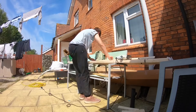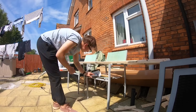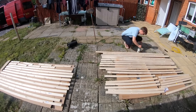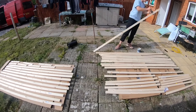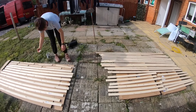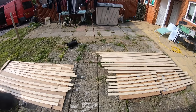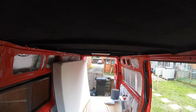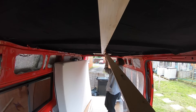Now we're on to the ceiling. I decided to do a stripped ceiling, so I got these planks of wood and stained them both sides. The stain wasn't quite the colour I was going for but I stuck with it — a couple of layers also helps protect the wood from condensation. I then carpeted the roof using a four-way stretch carpet that's used in vans a lot, going with all black so I just needed something to look black.